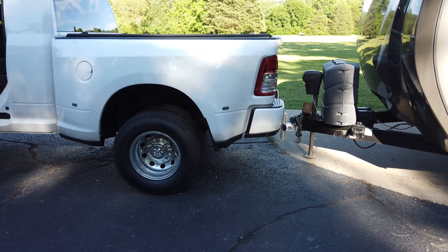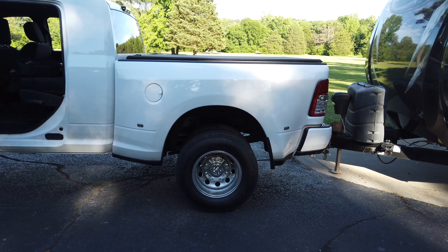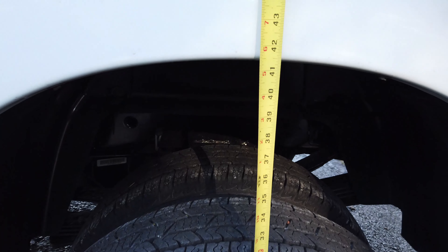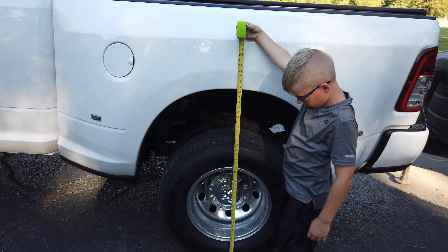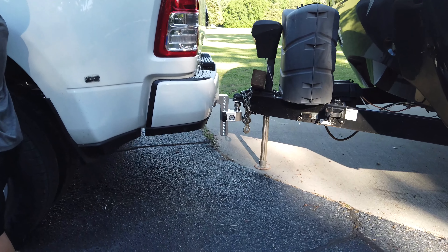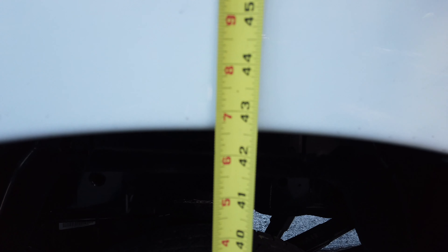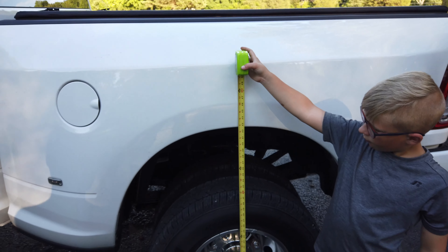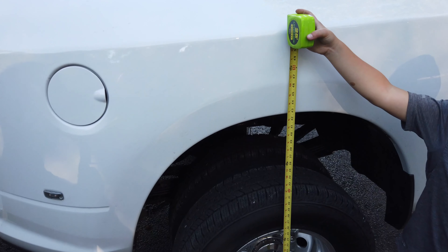So I'm going to measure the squat. It did pull the truck down some, so we're going to get the tape measure and measure it loaded versus empty. Jack's got the tape on there — loaded, it's right at 41 and a half inches. Now with the camper off, we're right at 42 and a half inches, maybe just a little over. So it really only had about an inch of squat, which makes sense — this is a one-ton, so it has heavier leaf springs, and the hitch weight is only about 700 pounds.